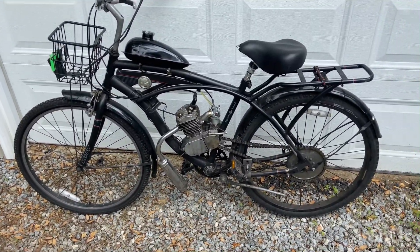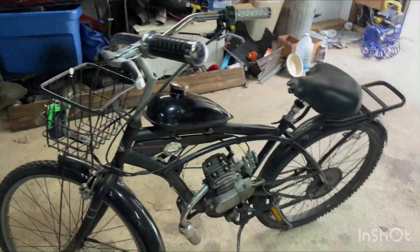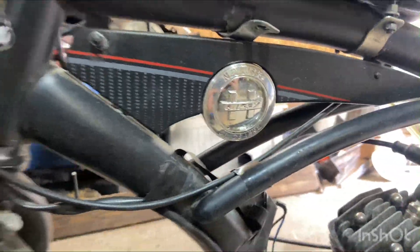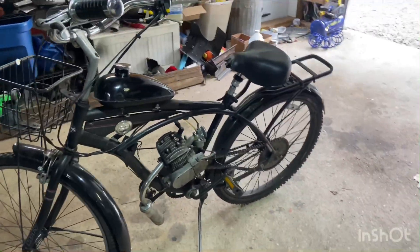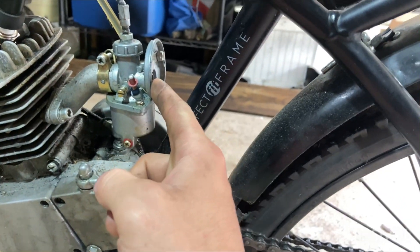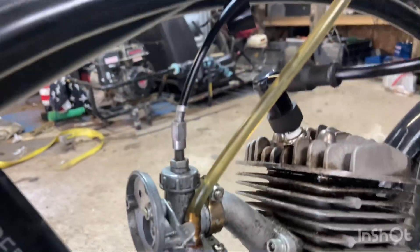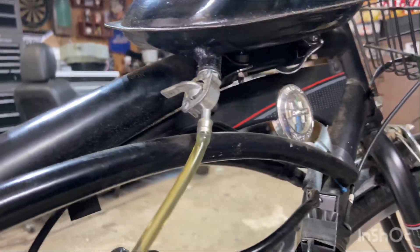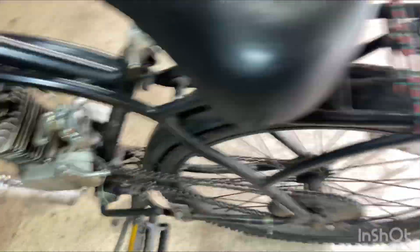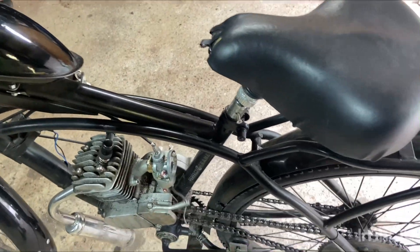So here she is — $50, came with a bunch of extra parts. We're going to try and get this thing running. Looking through it, looks like we have a Huffy Beach Cruiser, which is a Walmart bike. It's got a motor in it. The carb does not have an air filter on it, which I'll probably throw one on because I have a bunch of extra parts for these things. Somehow the fuel line doesn't seem to be leaking, which these things literally always leak, so that's pretty surprising. Fuel tank is mounted, kind of jank, but it's on. The chain roll is pretty good, which is a very good sign. The clutch actually does work, which is nice. Chain and clutch are half the battle with these things.